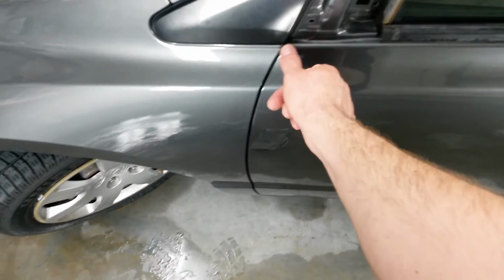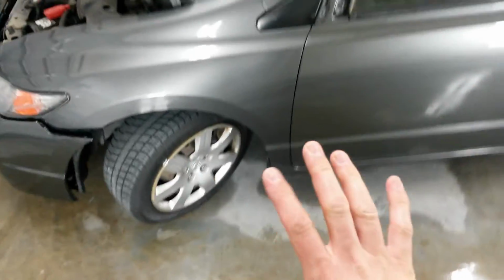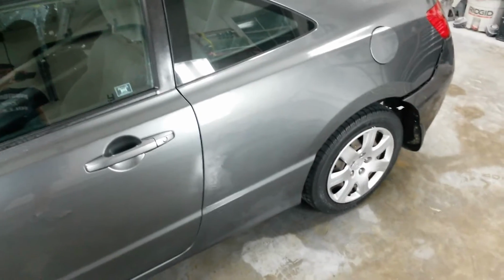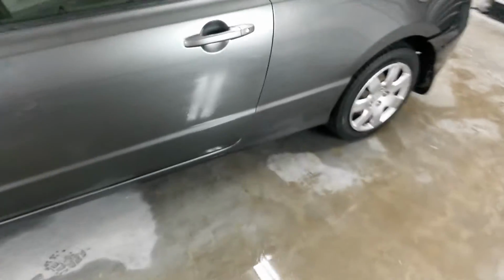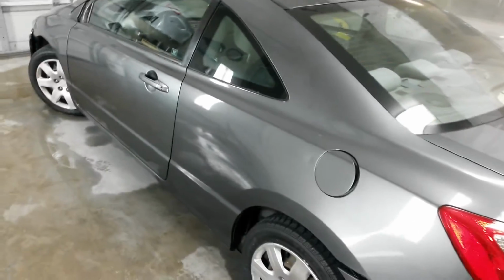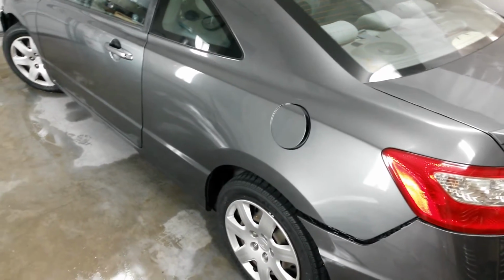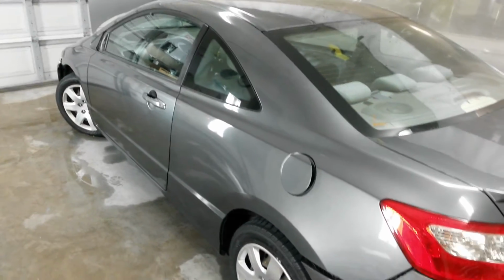We'll just tape along the door here to do the fender. So basically I'll have fender and I'll go around the top with the clear and then down all the way that way with the clear and all the way back under. So I'll just loop around the door. Hate to have to do this, but it's off enough that I don't want to send it out like it is. So I'm going to get to masking, and then I'm just going to sand all those edges, and I'm going to try not to damage my tape edges so I can just leave those. I'm going to get it taped and I'll be back when I've got it prepped.